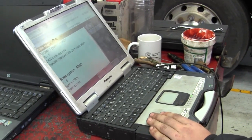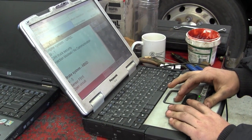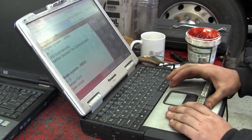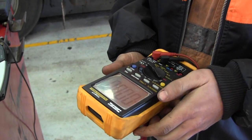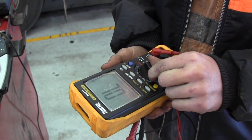Every part of the truck has got an ECU and they all read different sensors. This will pick up all the sensors and tell you everything — what's wrong, what's not right. It communicates all the different signals together and if it's not right it will put up a fault. These trucks are very electrical, so you go through all your settings and find the right settings for the application.